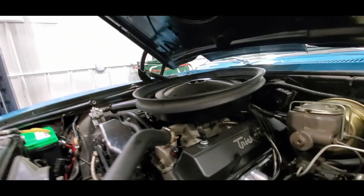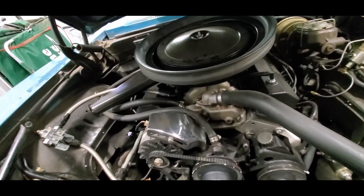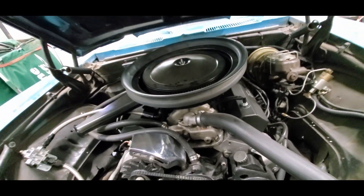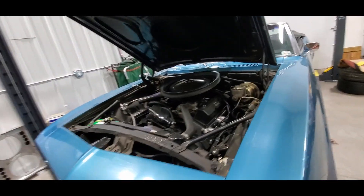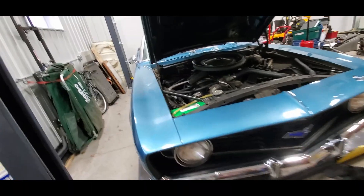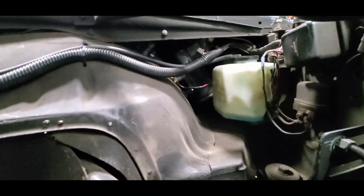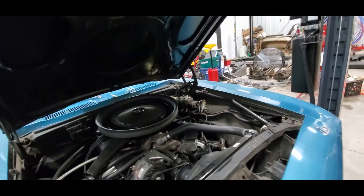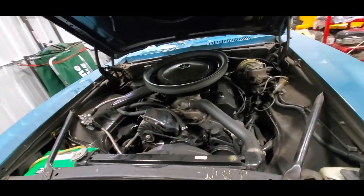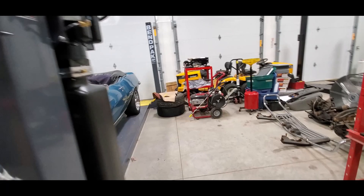I'm definitely going to pull some valve covers and kind of check things out. This engine draws very little vacuum, which is quite surprising — which means I'm sure we're talking 106 LSA and a large rumpity rump cam, because he wanted the sound. But I really want to evaluate whether that makes sense. Replacing that noisy vacuum pump — that thing is a nightmare, it's got to go. So does it make sense to replace it, or does it make more sense to pop the cam over to something with a wider angle, still get that rumpy, angry sound he wants, but make the car a little more drivable?